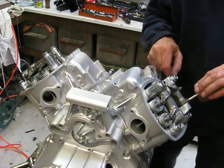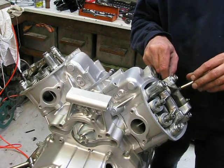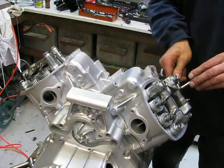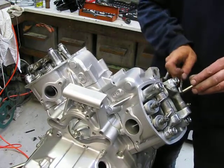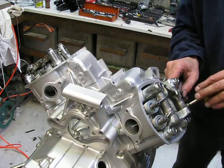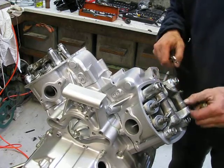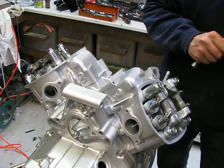When your engine is ready to ride, notice that everything has to settle and you have to change your clearance very fast. You're doing a great job now to put the clearance right, but after 150 kilometers you have to check it again. That's ready — go to the other side of the engine.